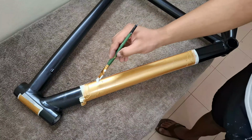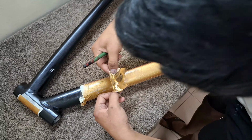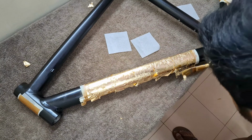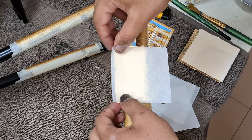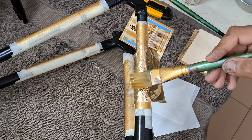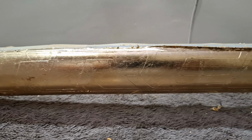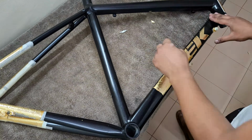Use a gold leaf adhesive which is transparent after drying and carefully place the gold leaf onto the logos. Use a brush, otherwise you can damage the gold leaves. When the adhesive or glue dries, you can use a brush to remove the excess gold leaf, and finally you are left with the logo covered in the gold leaf.